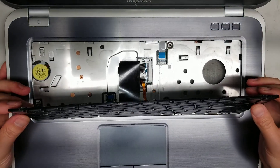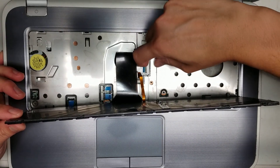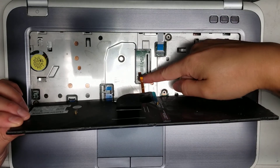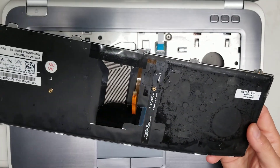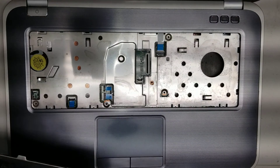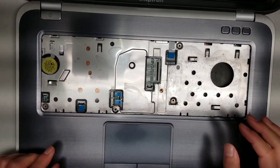Underneath, there are some cables. To remove the keyboard cable, you flip up this latch and then pull that aside. Same thing with the keyboard backlight cable — you lift it up and then you can pull the keyboard backlight out. So there's the keyboard cable and the backlight cable. Looks like this one had some liquid damage too, but they were saying just the screen is bad, so hopefully it's not also caught damage from the liquid.